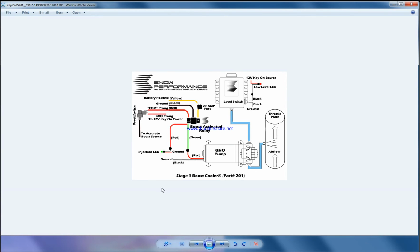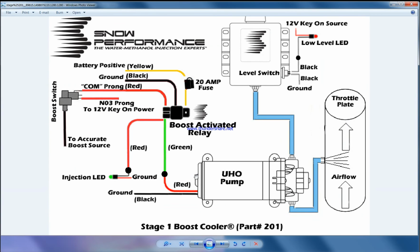And this one is a standalone kit. It has no wiring connection to any of the wiring harness on the car. So it's a clean installation, and if you want to remove it, you remove it as it is, no cutting, no connection from anywhere. It's a complete standalone kit used for a forced induction car, working based on boost. So this one is purely based on boost. It's a boost switch with a variable boost controller. You can adjust the boost. You can select a trigger point at which it starts working. That's it. It's just on and off at a certain boost.